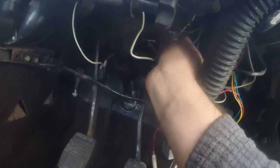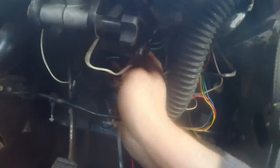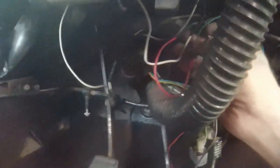Brake. Nothing on the brake light. I'll have to get under there and check we've actually got power. Anyway, I'll keep poking. I found I was getting 12 volts at the switch, but when it was on, I wasn't getting anything. Basically, the switch is either badly adjusted or it doesn't work. So I've put a bridging wire in there, and lo and behold, I get one brake light.